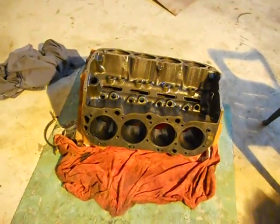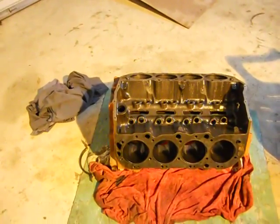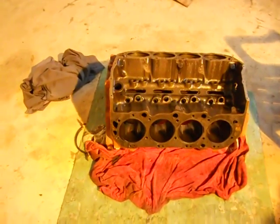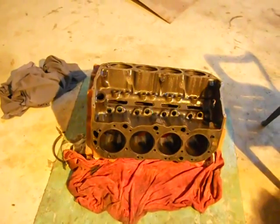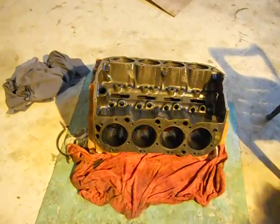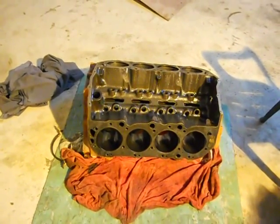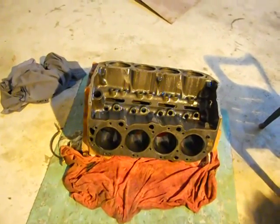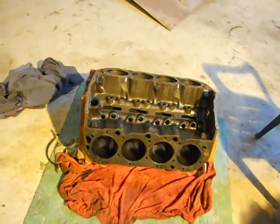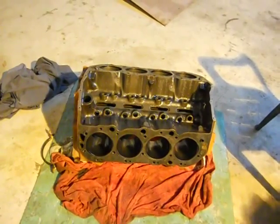I'm going to have to check with the machine shop. But that was our knocking noise, folks. Loose pistons. I'm not sure what the specs are or the max tolerance is, but 7 thousandths more than what it's supposed to be is probably going to make a little bit of a knocking noise in there, with new pistons and honing it as hard as they did.